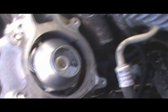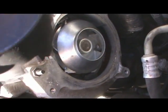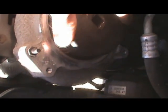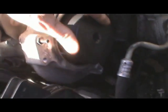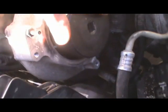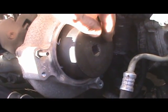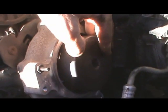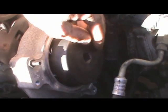I have already installed a new water pump. I will show you here how this tool goes on — it just goes on there like that. Use the same tool to put it on as you do to take it off. You might need a little cheater bar to help you get it on and off. Don't use an impact on these because this is aluminum and you will crack it. I just used a little cheater bar and it came right off and the new one went right on.